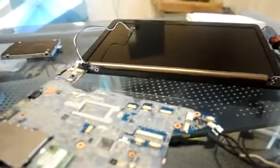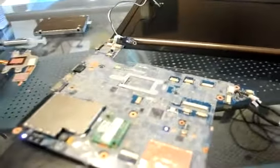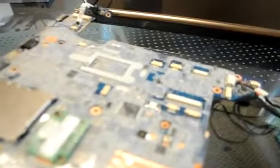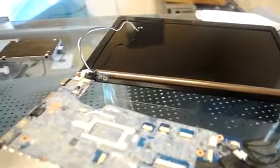So now we're going to turn the system on and see if the change of the processor is actually what's going to fix it. We have the lights on and we're going to check to see that the screen turns on. We got a backlight and an initialization — it looks as if we have an actual screen. F2 takes us to where we need to be and we have boot up and everything. The system has turned off and it's turning back on, which is pretty common with a system that we have in diagnostics without heat sinks, but it's working.